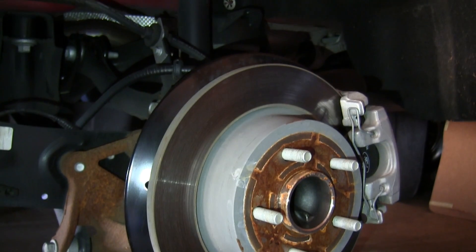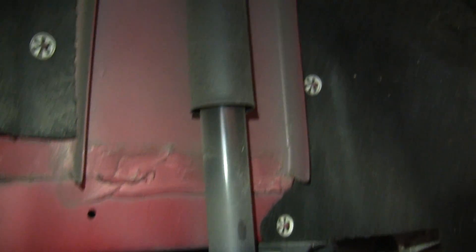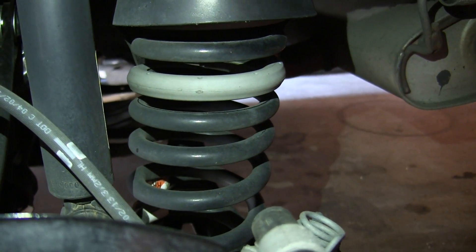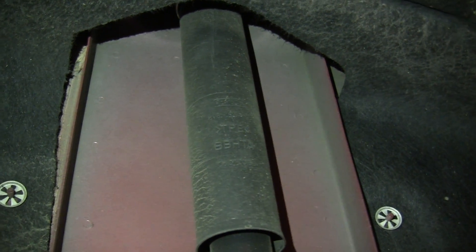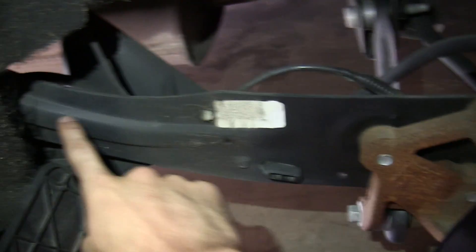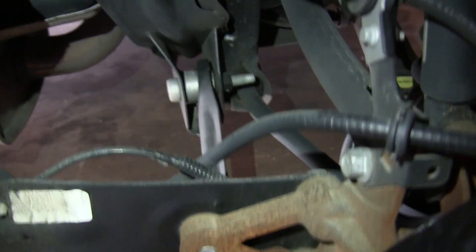In the rear there are 11-inch solid discs and a separate spring and shock multi-link suspension. By placing the spring separately they're able to move the shock closer to the body and not have the spring intrude on the trunk space. We've got a trailing arm link here, a link here, an upper link to restrict it to vertical movement, and the stabilizer bar with its connection.